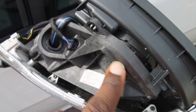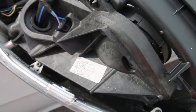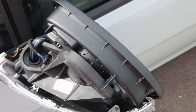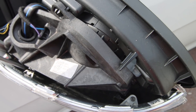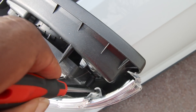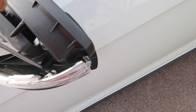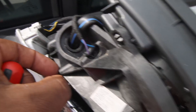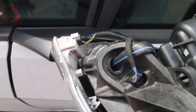Once you get the cover off, you've got two screws down here - Torx screws, they are a T9. You can use the tool they sent, but I'm going to use mine as it's much more comfortable. You literally just unscrew those two Torx screws - here's one and here's the other. Then once you get these off, it's just a case of unplugging the connector and swapping out. As simple as that.